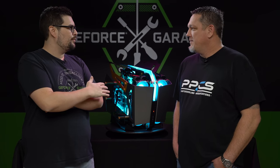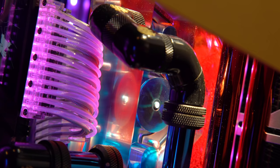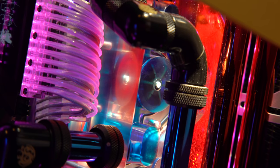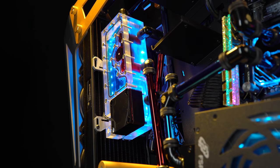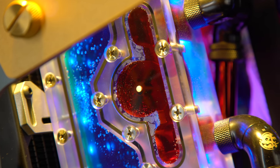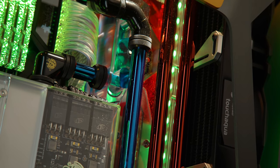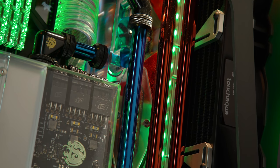Is it an easy case to put water cooling in? I would say it's pretty straightforward to put water cooling in, but the way I did it — no. All the water cooling is Bits Power, and Bits Power has a reservoir with a flow meter built in as well. The flow meter is separated from the reservoir. What I did is I took the same reservoir for both sides and ran the flow meter from one side to the other and vice versa, so you see liquid from both PCs on each side. It complicated things because I have all these red tubes and then all of a sudden there's a blue tube that pops up.